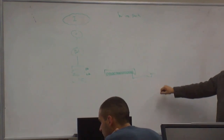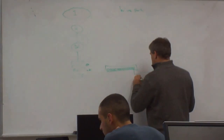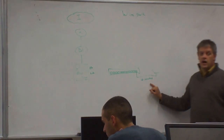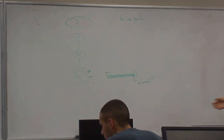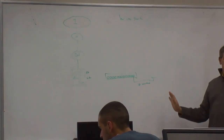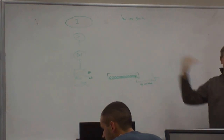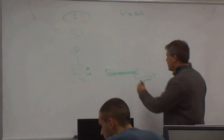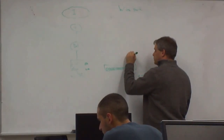What you have to do is connect one port to your laptop or whatever PC is going to be doing the sniffing. This port is an IP unnumbered interface, meaning it does not have an IP address. It is layer 2 only. It's capable of sniffing Ethernet, IP frames, everything else. It has no IP address of the sort. Can't get on the internet, not routable. All it's going to do is be a repository for packets and frames. So, this switch port is commonly called a mirror port.